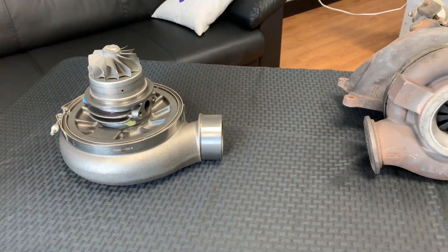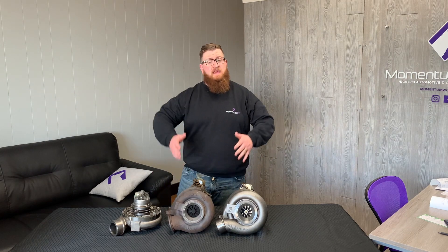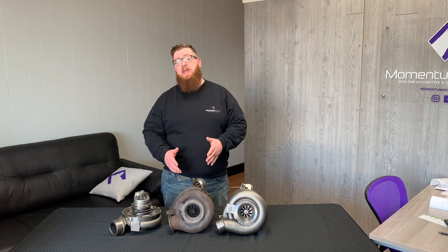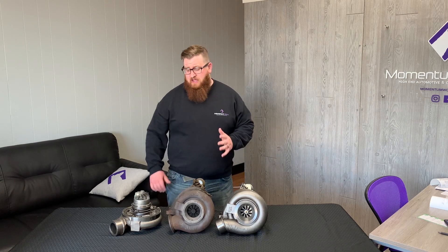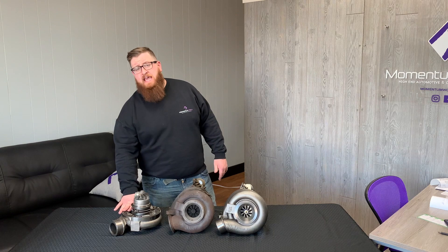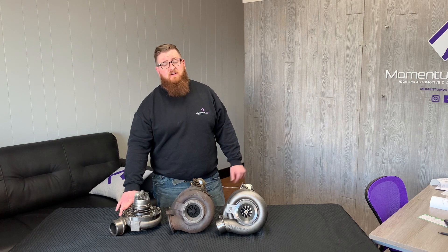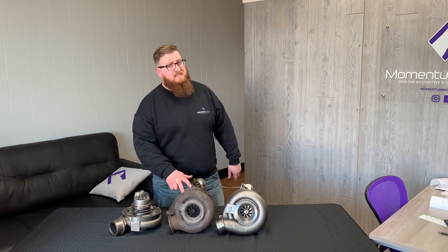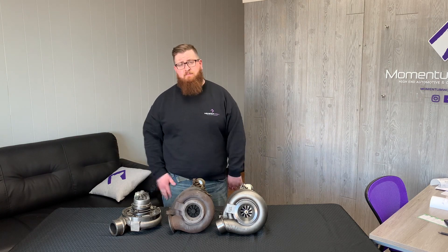So we covered the difference between the SDP and the MXS, BXS, and NXS high pressure turbos. The SDP turbo we have here is a core turbo, which is why it's a little rusty and beat up — the new turbo does look a lot better. We wanted to introduce our new super core: you can buy this as a super core with a genuine Garrett SDP high pressure cartridge, and it already has the compressor cover you need for it to be a direct swap on your MXS, BXS, or NXS truck. You just get an SDP turbine housing — either by buying a whole core turbo or just the housing — and then you have a complete turbo ready to go.